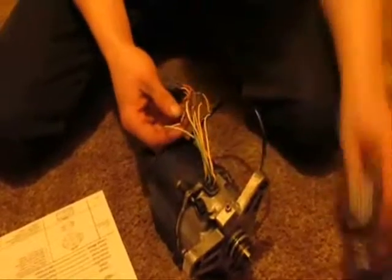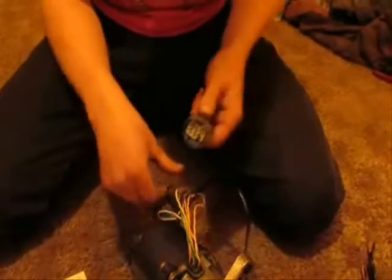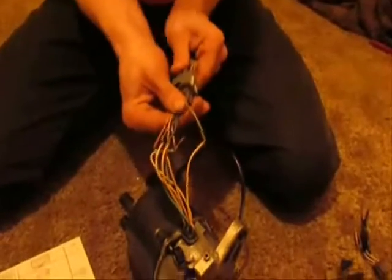What I did was I printed off a custom made diagram showing where everything goes on the ECU and whatnot. This down here has the SI connector and tells what the functions do, what the colors are. And this is the OBD1 connector, colors and function. So I pretty much just match the colors up. I'm going to solder them and then solder this onto the car, which will be another video. Then I'll be able to drive my car around until the OBD1 conversion harness gets in.